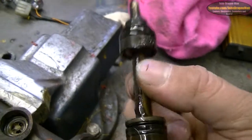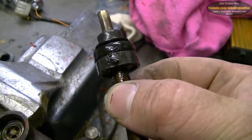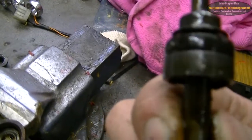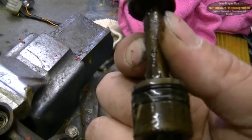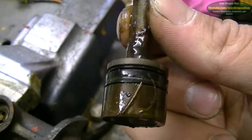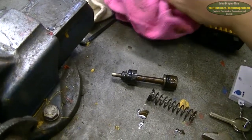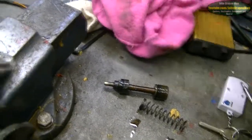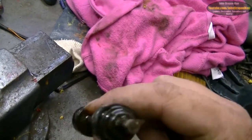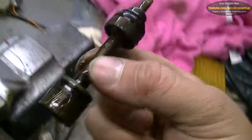All of that was in my braking system — terrible. And as far as the rubber seals go they look pretty good, but it was just the sheer fact that they've got all that crap and gunk in my master cylinder. It must have been dragging all that through, and that is what was causing my brakes to fail. I mean obviously I flushed the system out numerous times but I didn't realise that was the fault.